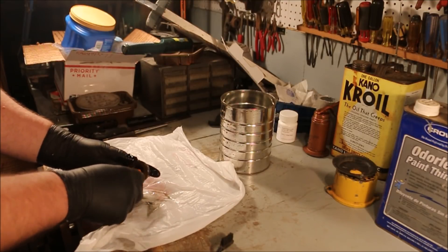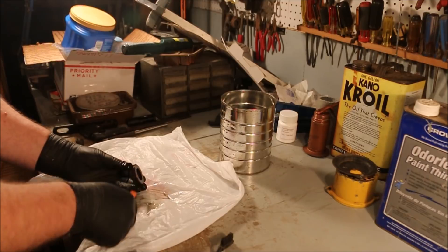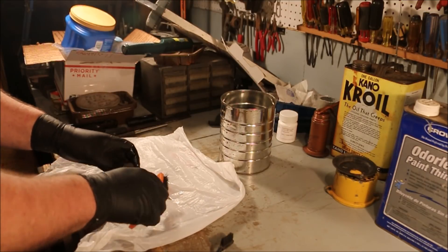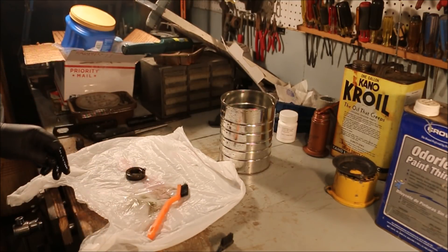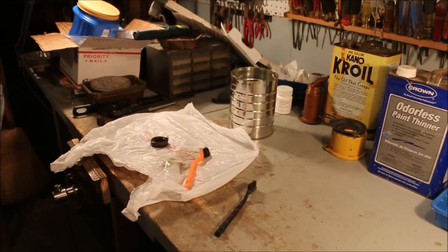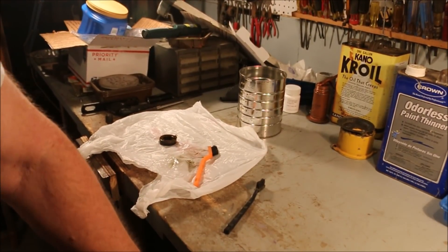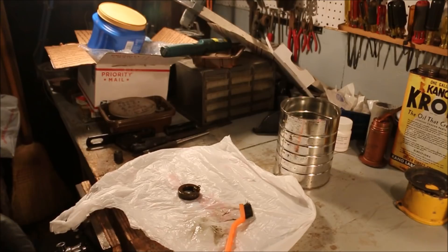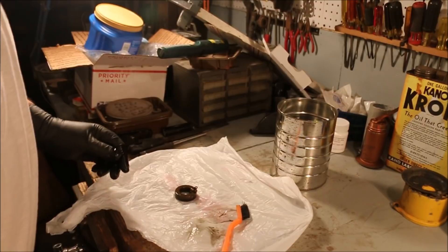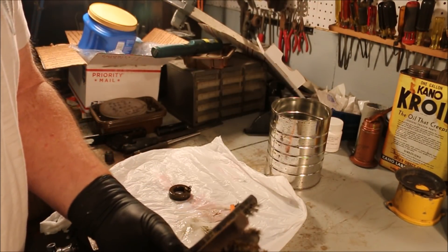You can patch them, but that's not an easy process. It's made out of formed brass soldered together with lead solder, so it is repairable. But it's not as important to have it perfectly shiny clean as it is to have it not leak.